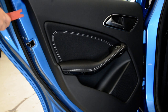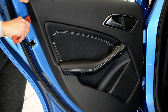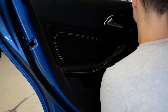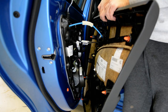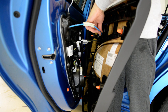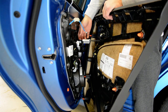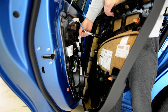If you want to remove the door panel, you will have clips along the side of the door panel. You will have one cable to disconnect — this cable for the locking mechanism. Pull this blue wire, take it out, pull up. Here you will have two tabs on the right and on the left — push them and take it out.